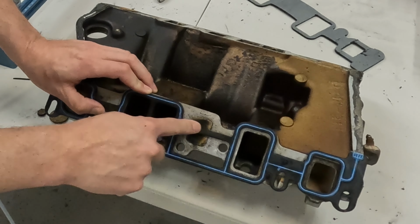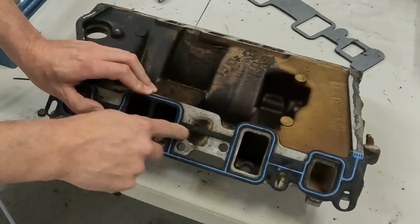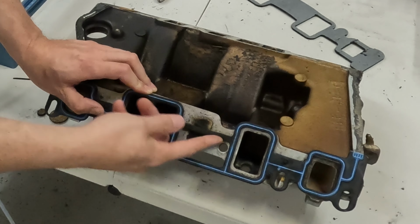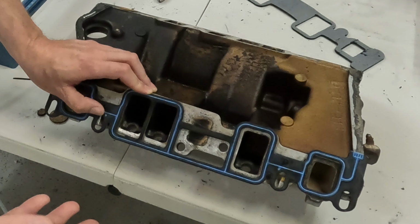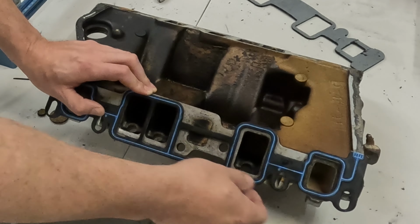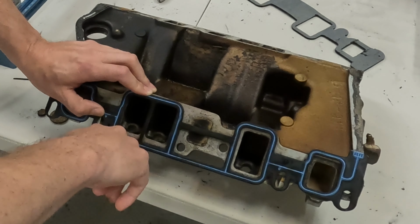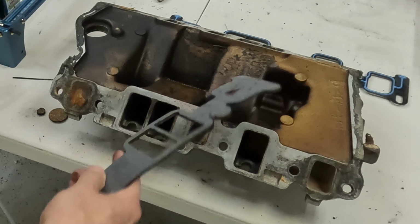But as you can see, this big block right here, there is no rubber on that. I tried to RTV this down to the head and the intake manifold. I don't know that it's sealed. And I think we were getting most of our exhaust leak, our crankcase vapor leak out of this area. And it's just not feasible to really build all that up straight across. Whereas on the Vortec heads, our lower intake manifolds, that is a straight run across there, and that would seal up better. So here is our multi-layer gasket that I have made.